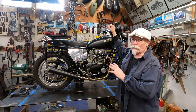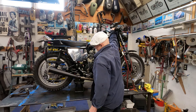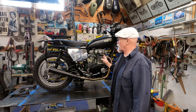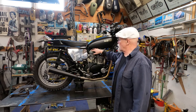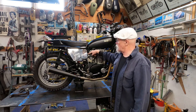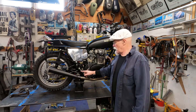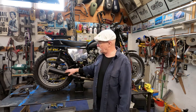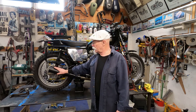I've gone through and adjusted the carburetion on this. I did get a larger carburetion kit because we are running the more open filters and basically a straight-through exhaust. This exhaust runs basically straight through, but it's perforated and it has a wrapping in here.